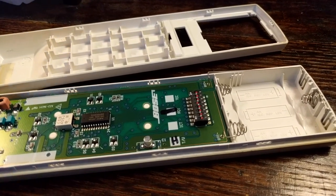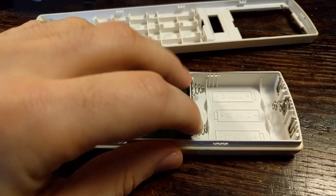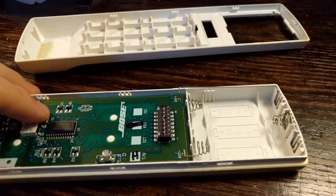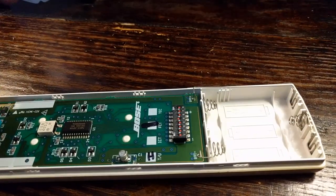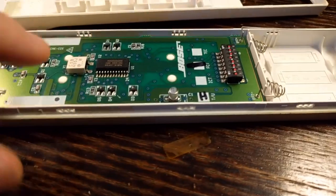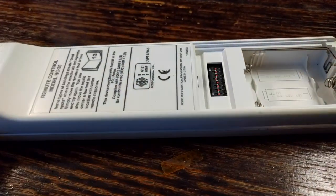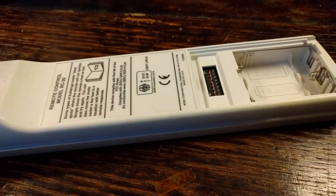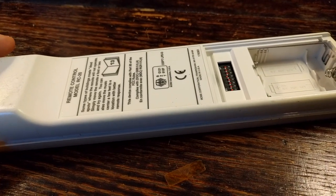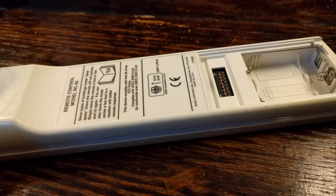Finally, to reassemble the device, you'll want to first get the buttons back in, then get the board back in along with the terminals securely fastened to the housing. Once you have that, it's always a good idea to put some batteries in and make sure everything's working before fully closing it up. Then take the back panel and snap everything back into place. If some tabs were broken during disassembly, feel free to use the adhesive of your choice. Putting the remote back together it may not be quite as tight as it was originally, so that might be another reason to use adhesive — but it'll look pretty good without it. Thanks for watching.